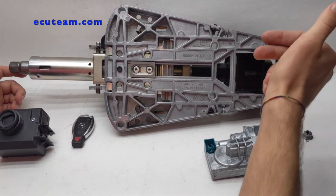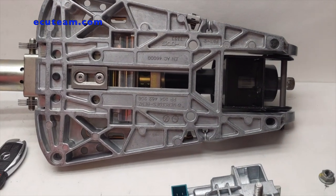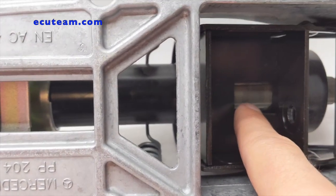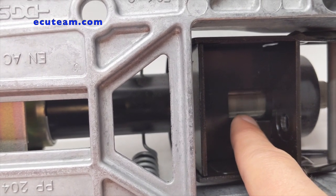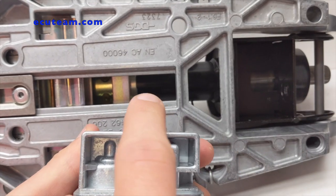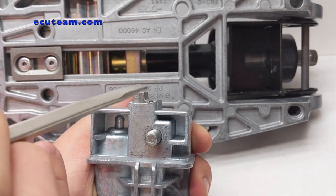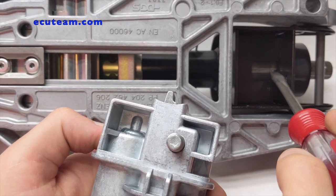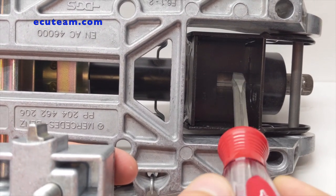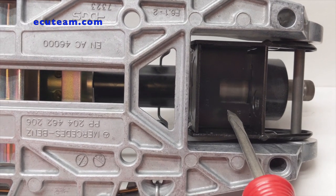This is how it looks. If you look a little bit closer inside, you'll understand how it actually works. On the steering column — by the way, you can spin it right now because it's not locked anymore. If you look closer right here, you're going to see that it has some sort of metal stoppers or edges. Take a look at this mechanism — you see this little latch? If I press it like this, it's locking and unlocking. This little thing is located right inside here, and when it's locked, this position is called the locked position. When it's locked, you won't be able to turn the wheel, but right now because the steering lock is removed you are able to spin it all the way around, no problem.